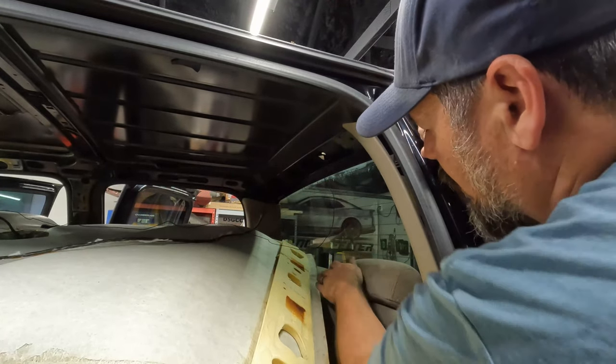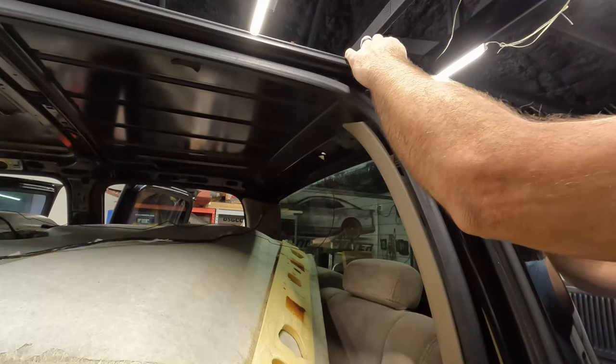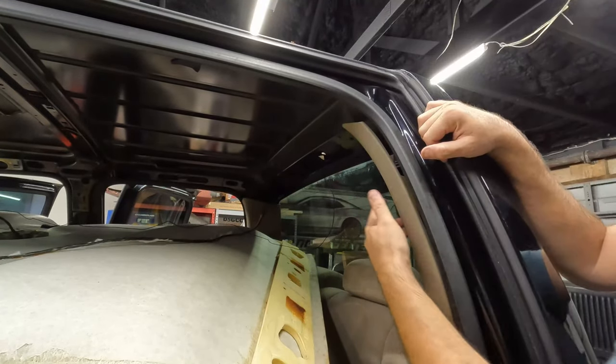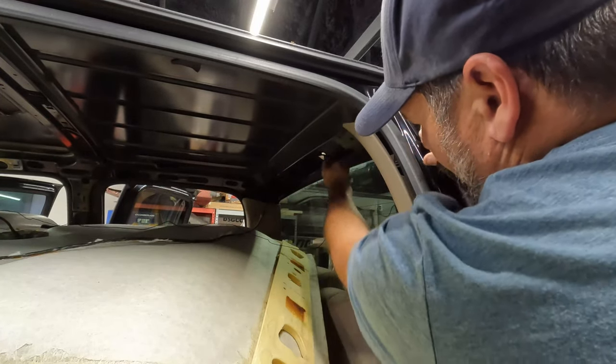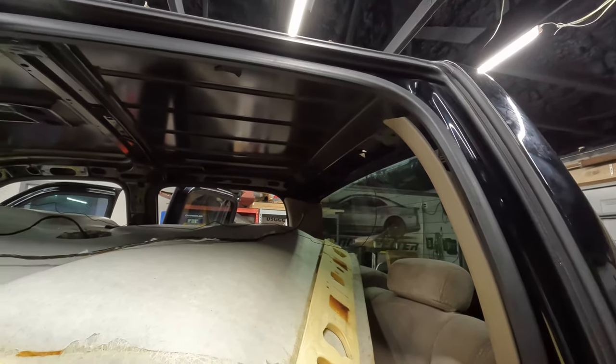It's got water damage all along the back. So it's been leaking back here somewhere. It's like up in this corner. Might be around the brake light, because the brake light has got a little bit of rust around it. So I wonder if it's leaking and then running to one side or the other of this beam.